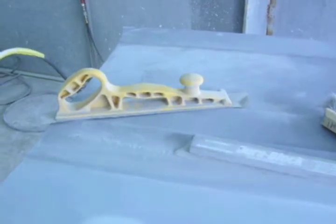Not only do you have to put hoods and deck lids on stands very carefully in consideration to the supports underneath that press up against the outer skin, you also have to evaluate the damage very differently. In your metalwork stage, you must determine if any highs and lows are caused by the supports themselves. You can check this by dinging lightly on the affected areas to see if it feels more dense and more solid than it normally would. Kind of like drywall with a 2x4 behind it. If there's too many areas like this, they must be separated from the supports and re-adhered to the outer skin. You can cut it away with the mini air saw, but a good scraper will work as well.